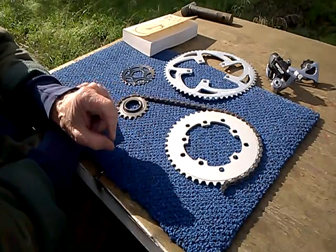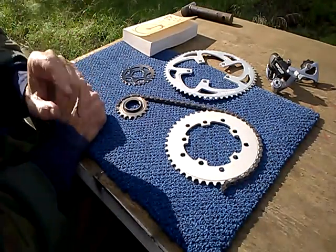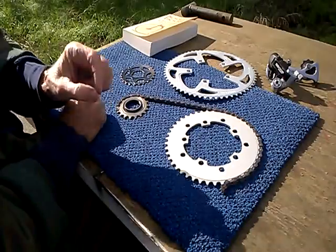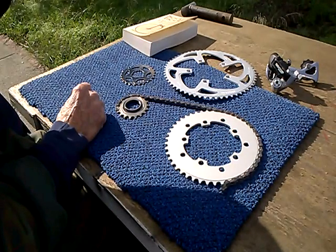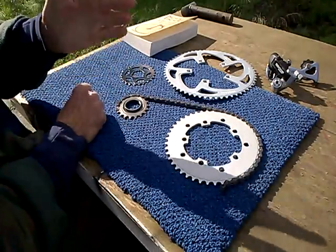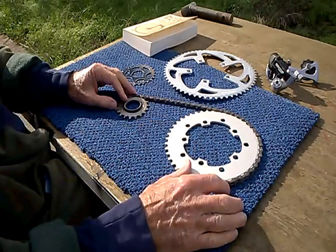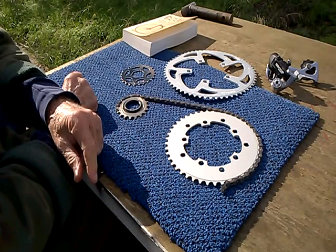Is that an appreciable amount? Yes, it is. Now, maybe not to a machine that's measuring watts, to a machine that's measuring drive efficiency, but to a human being pushing pedals with their leg muscles, they can certainly feel that 5 to 10%. Absolutely. I know I can. I've made the trip up and down my hill, 1,000-foot elevation change, over 10,000 times. And I've taken bicycles that I've ridden with, say, 12 to 18 speeds and cut them down to one speed. And I can feel the difference. Yeah, for a given number of gear inches in a multi-speed bike compared directly with a single-speed setup of the same gear inches, the single speed flies up the hill.